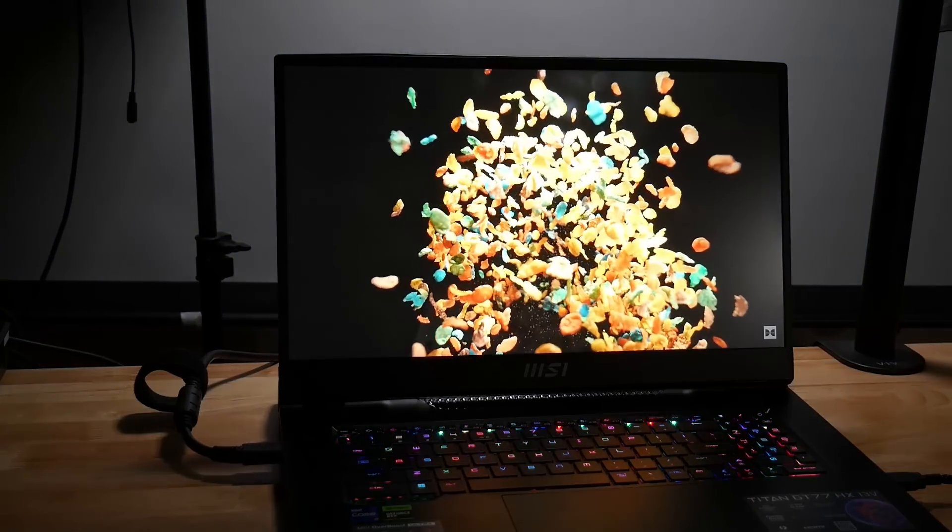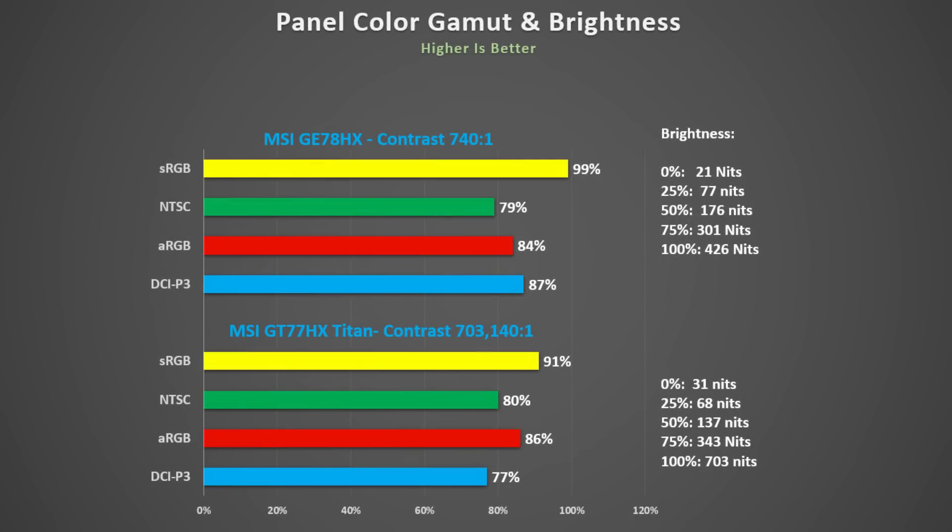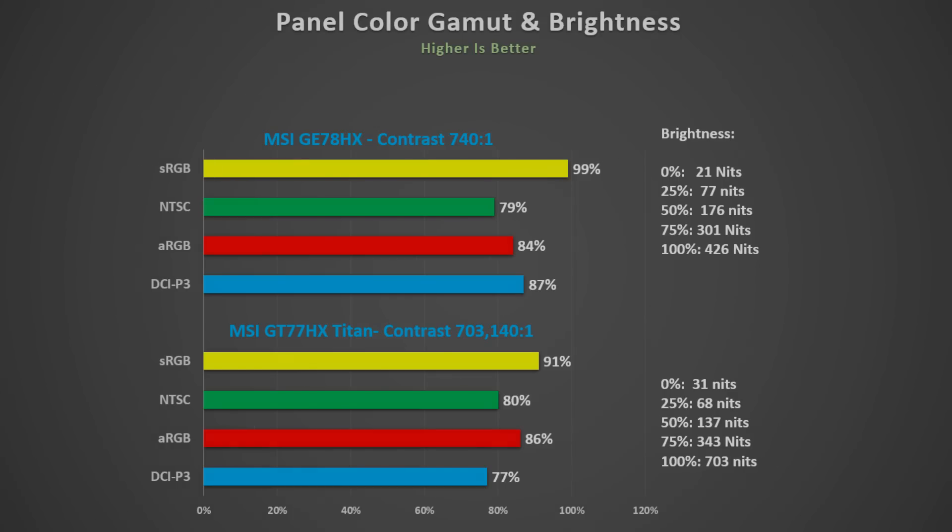This is the first mini LED display I have seen and the AUO panel has excellent blacks — comparable to an OLED — and showed no backlight bleed whatsoever. The colour gamut is pretty decent and it is super bright, maxing out at 703 nits. Contrast was also insane, many levels better than the typical IPS panel. I did a white blooming test at a shutter speed of 1/1000th of a second and could see no blooming. If you increase the shutter speed, a striped pattern emerges because the backlighting doesn't turn off completely — only a small part of the mini LEDs are turned off, whilst the surrounding mini LEDs illuminate the switched-off part.